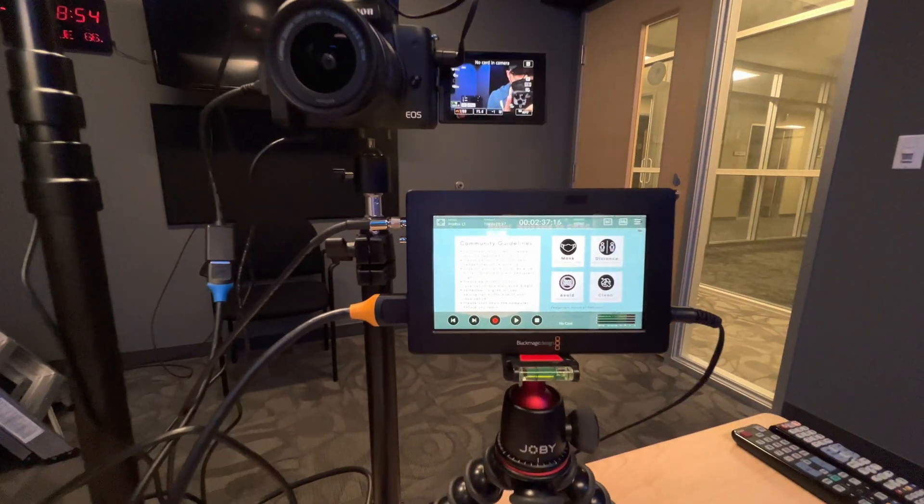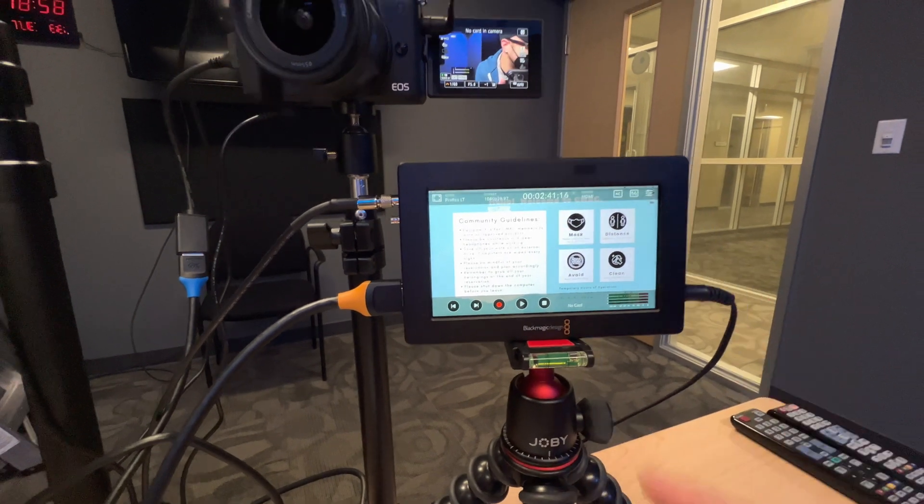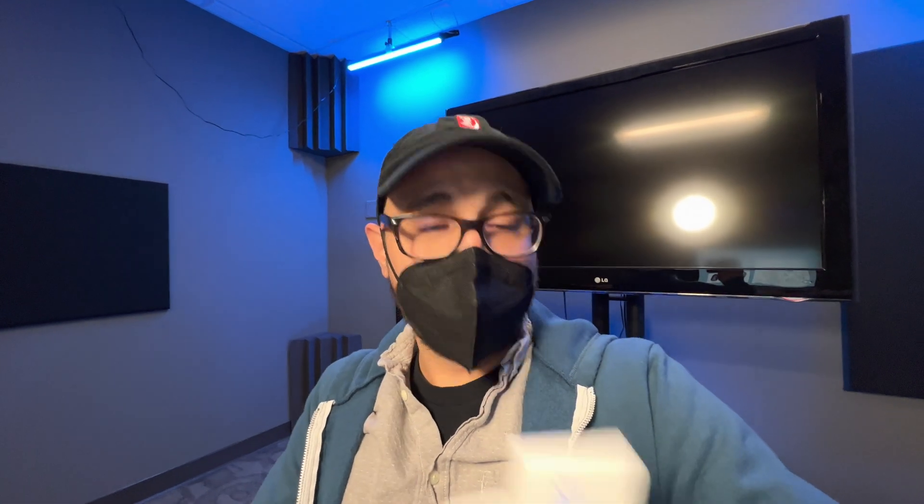The screen flickered, but we've got a solid connection. One of the adapters I've never tested because I thought it was too expensive at the time — but now those adapters are going for like $80 plus — so I picked up an Apple USB-C HDMI adapter. It does USB-C pass-through, HDMI, and USB 3.0/3.1. I want to see if this adapter, which is easily available at about $60, works well with the ATEM Mini input.